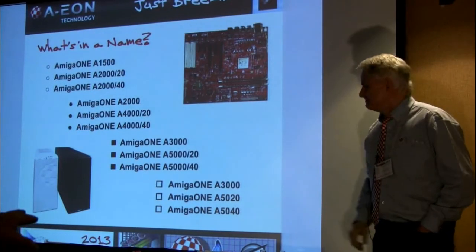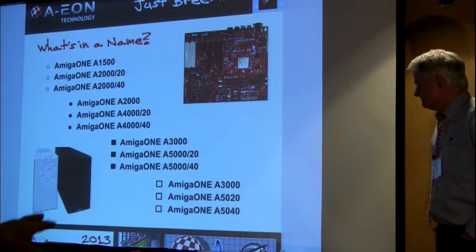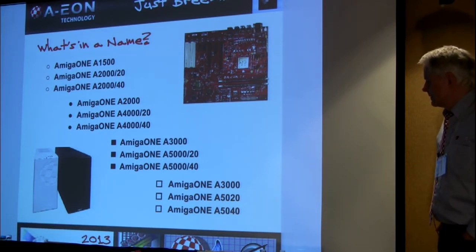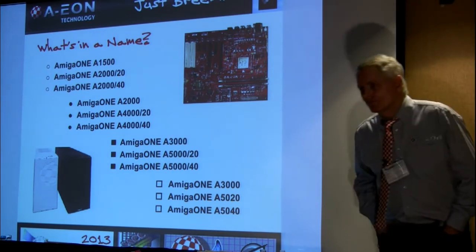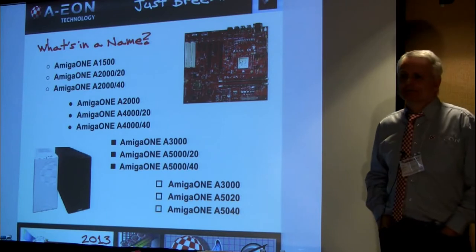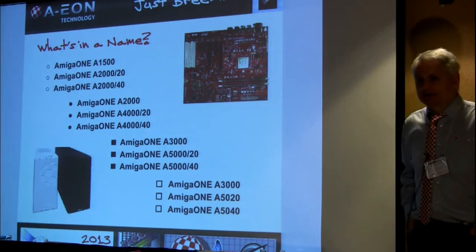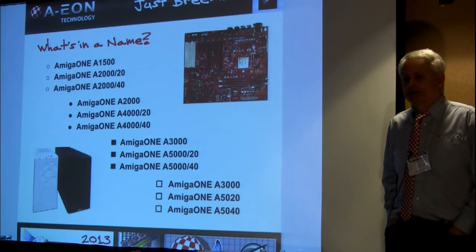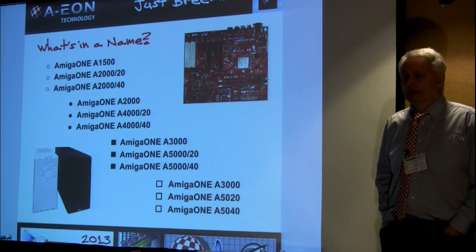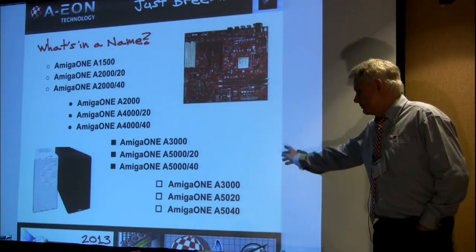Okay. Why, in the last example, for instance, why are you calling the first option an A3000 rather than an A5000? It's a different series of processors. It's a 3041, whereas the other board is a 50 series, P5. That's the main reason. And also, the two other boards will support 16 gigabyte RAM, whereas the one above will be 8.